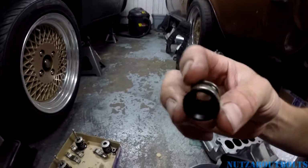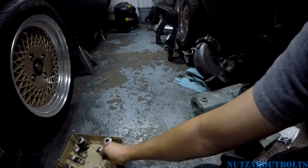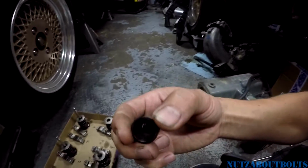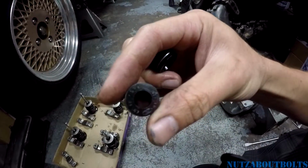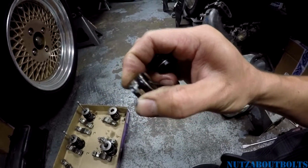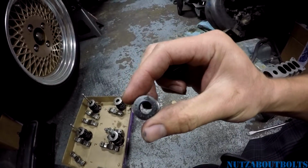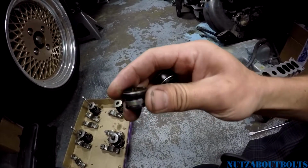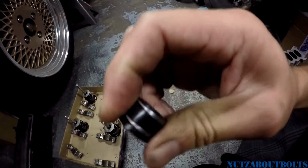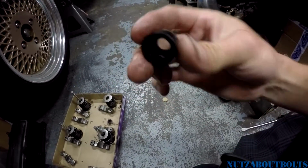The reason I'm doing this in the first place is these valve stem seals are getting pretty bad. Actually, that was an exhaust one. The funny thing is, this is a Ford 2.3 4-cylinder head, by the way, the exhaust valve stem seals are made out of probably a higher temp, more durable type of rubber, and they're still pliable. The intake side ones are made out of cheaper stuff, I guess, and they're rock hard.